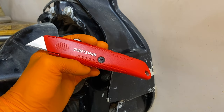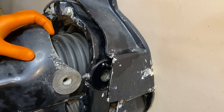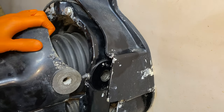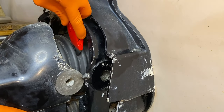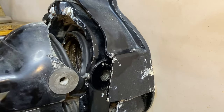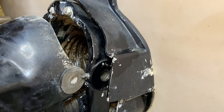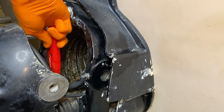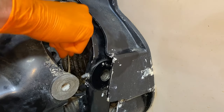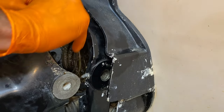Grabbing a Craftsman utility knife with a fresh new blade — all I'm going to do is pull out on the rear portion of the bell housing exposing the U-joint bellows, go in between two of the accordion lips, and make a cut. Cut all the way through, then do the opposite side, cutting the entire bellow. At this point, carefully remove the coiled wire inside the U-joint bellow itself — it just comes right out.